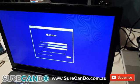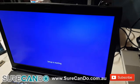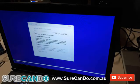And you don't need a serial number, it's built into the motherboard, so it will pick it up automatically and activate Windows automatically. And if anyone out there has a solution where, when you clone a SSD from M.2 2280 to NVMe, and find a way to fix the Windows boot, I'll be very happy to hear about it, as I haven't found a solution yet.